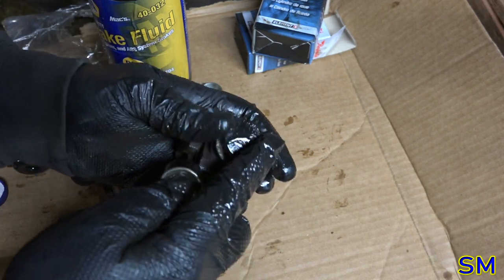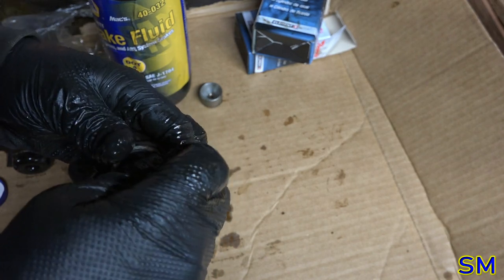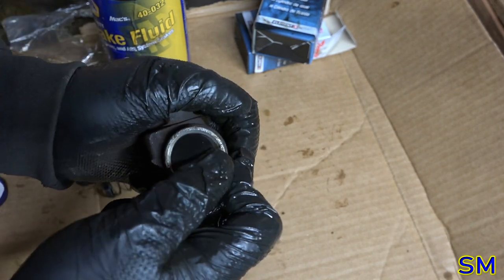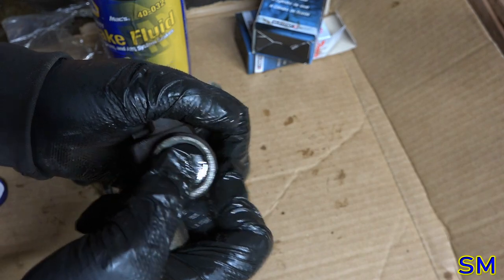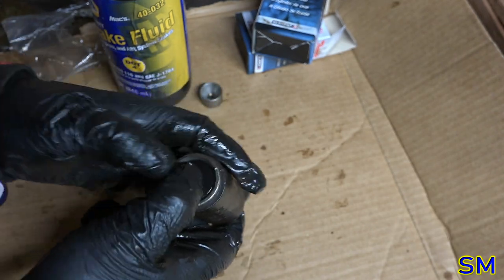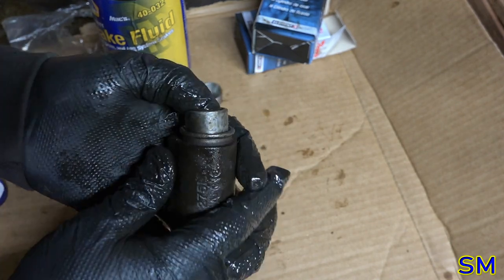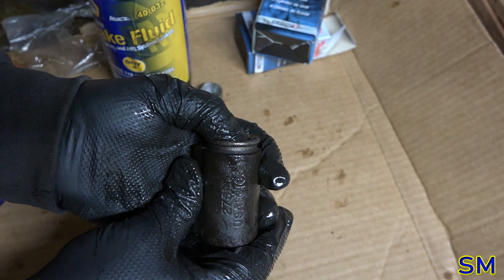I wonder if I could just push them in through here, eh? As long as I'm very careful with the seal. Really don't care to drag those pistons over that rust pitted area. Although I did hone it, but still. Yeah, that should work too. Dumb enough, if you put the piston in, it'll go down evenly.